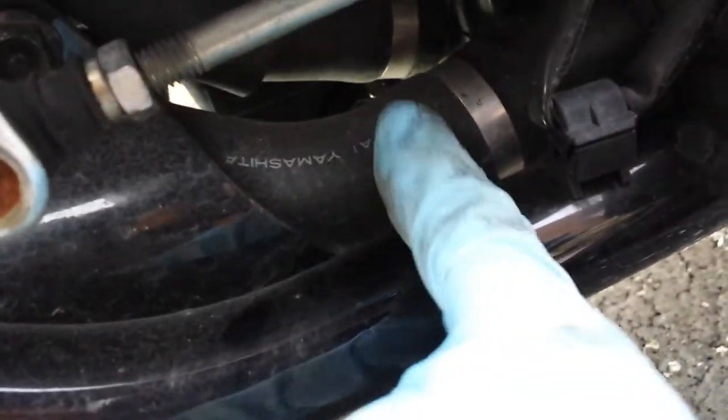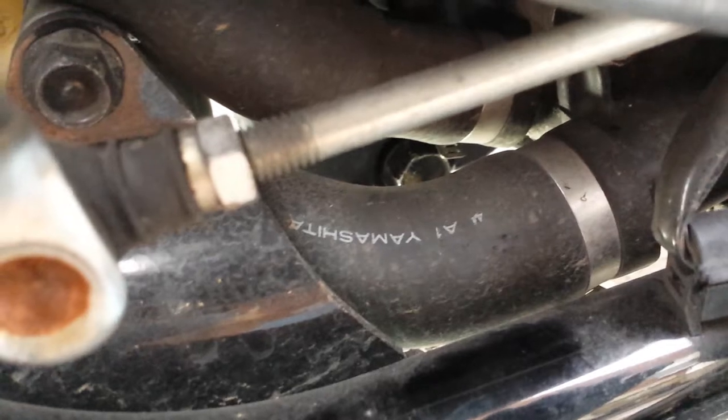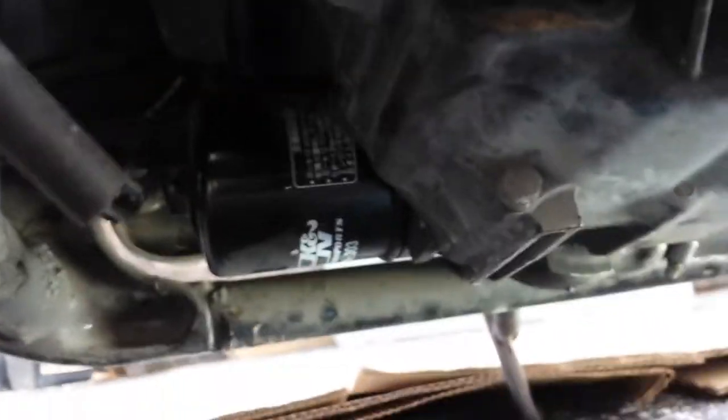That's the water hose and the plug right here — that's 17 millimeters, you can see clearly. Because that's near the water hose, you can't go straight in to plug in that oil plug, so you have to use a wrench with the ratchet. You can see it clear underneath — that 17mm is right here. And the oil filter is just behind that.